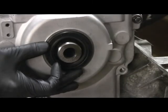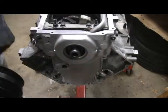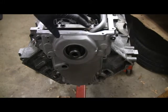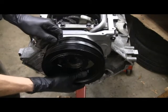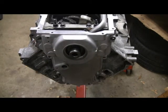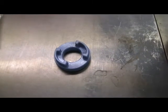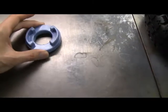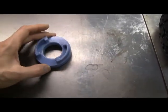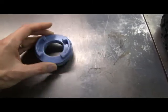The seal actually seals off on the harmonic balancer. You can't put the harmonic balancer on and then put the seal on — you have to put the seal on first. Now, some tips from the internet were to put the seal in the cover, leave the cover loose, until you put the harmonic balancer on — then it can kind of self-center like the rear. GM makes some special tools that will center the cover, but of course they're expensive and hard to get. But I found somebody that made a tool that would definitely help with this. It's about $50 on the internet, but I actually made this one — I took some measurements off the cover and off the crank and made this on a rapid prototype machine at work. I was pretty lucky to have access to that.